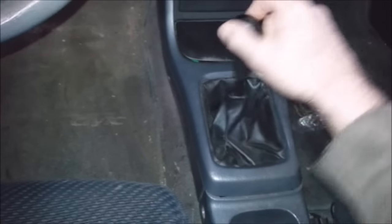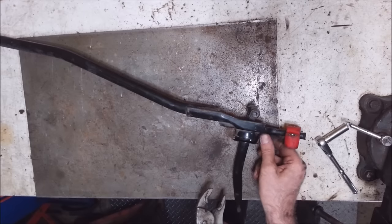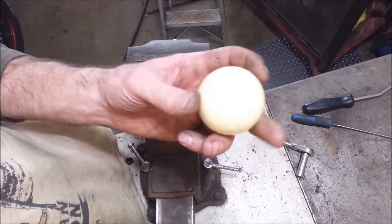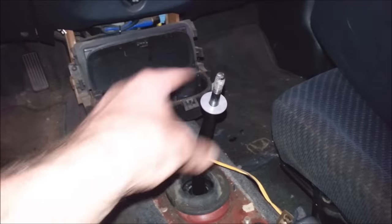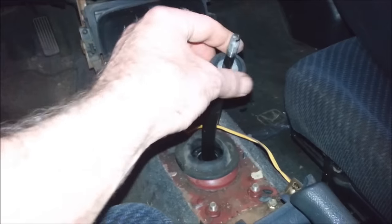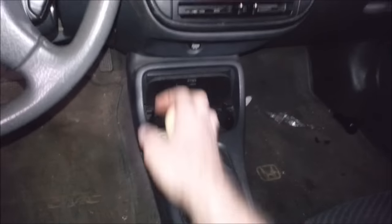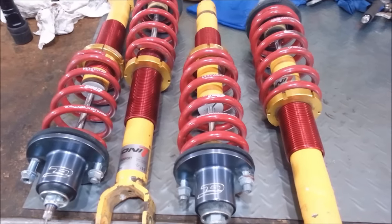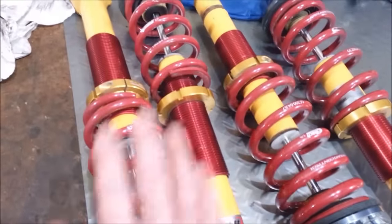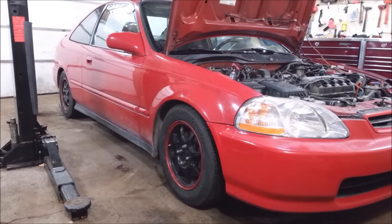My shifter's really floppy and the shifter knob threads are all gone on it. I'm not going to do the short shifter thing — some of them break. I'm going to fix it by putting a fender washer on here with a rubber grommet. I think this one's from a valve cover — I cut out the inside and I'll lay that over it. I found a used set of Koni Yellows with Eibach Ground Controls, with the Ground Control top hats.